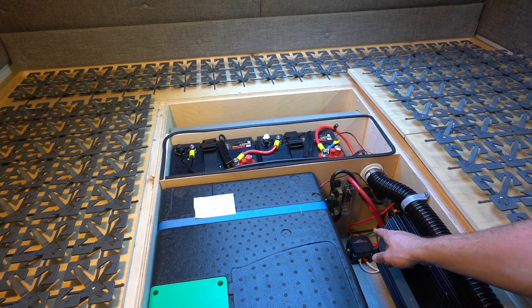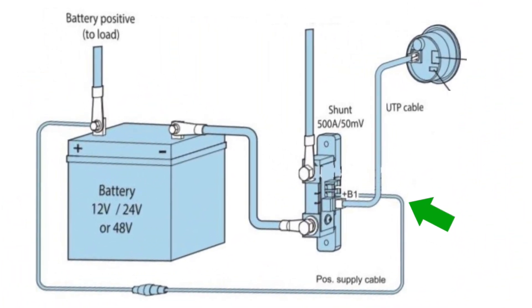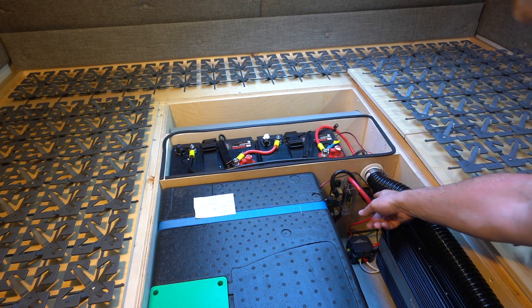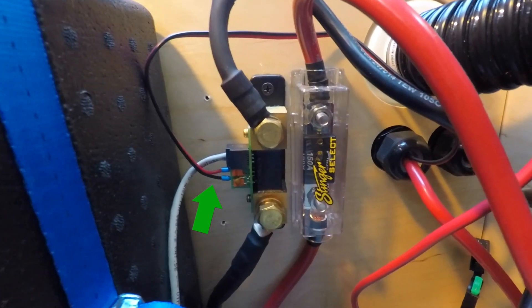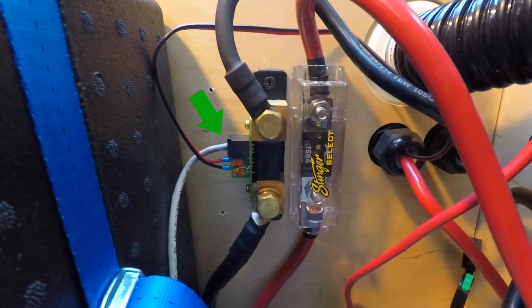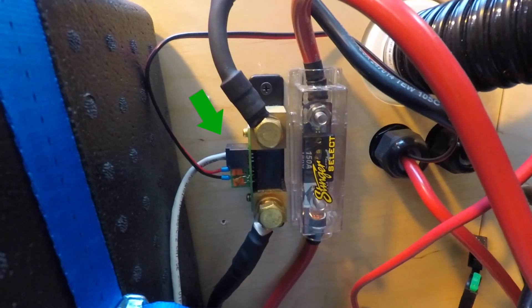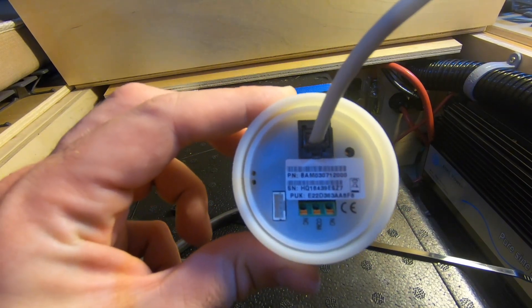The only other cable you'll need to install is a small battery cable that goes from the other end of the shunt to the main distribution block. At that point, you have power back to your main distribution block and the whole thing is operating like normal. Once you have these two cables connected, start connecting the positive voltage cable. When you bought the kit, it came with a little wire — either a one-wire or two-wire probe. You put one of the lugs on the main positive cable, run that wire through the same grommet that the positive wire comes out, and connect that into the shunt as well. Finally, connect the head unit with a little telephone or Ethernet wire that plugs right into the side of the shunt. Once you have that plugged into the back of your battery monitor, you're done with the install.